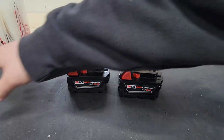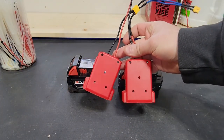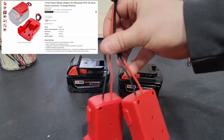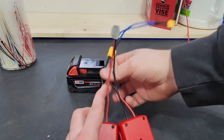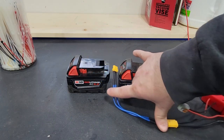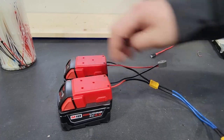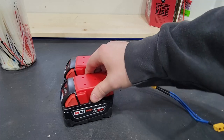In order to do that, you're going to need to buy the M18 power wheels adapters. I got these off Amazon — I believe they were like $10–$15. To wire them in series, you hook together the black and red, and then the other two go into a connector. I have a little adapter here, so you just clip this in and you've got yourself an e-bike battery. This will plug directly into the e-bike.